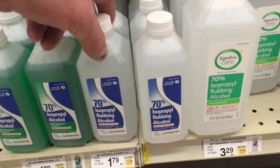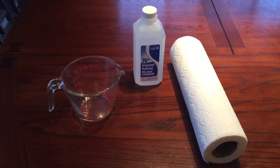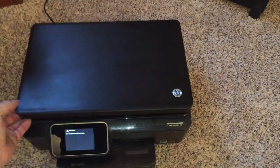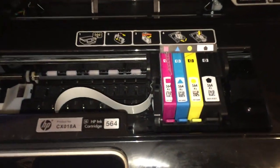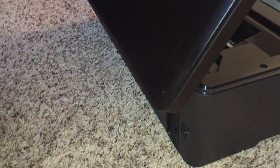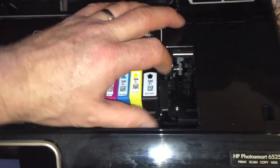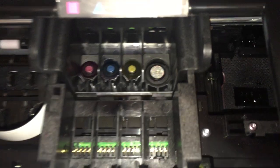The procedure involves a mixture of water and isopropyl alcohol — a 50/50 mix with hot tap water. To prepare the printer, if it's plugged in, go ahead and open the top cover to expose the ink cartridges. Once the ink cartridge carriage moves to the service position, go ahead and unplug the power, then remove the ink cartridges.